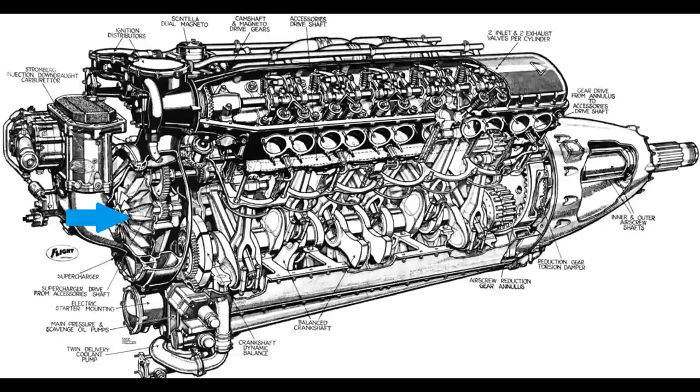The solution, at least in the case of the P-40 and many other early warfighters, was to gear the supercharger so that it would have maximum manifold pressure with the throttle fully open — equal to the maximum allowable amount of 52 inches in this case — at about 12,000 feet. Of course, that means if you fully open the throttle at sea level, you will overboost and likely blow the motor, so the throttle simply isn't opened all the way until about 12,000 feet.